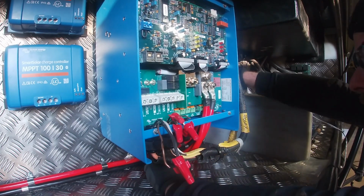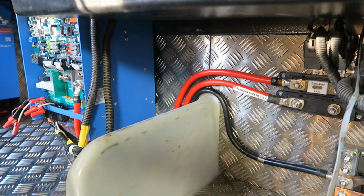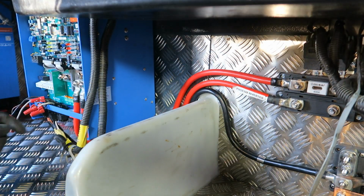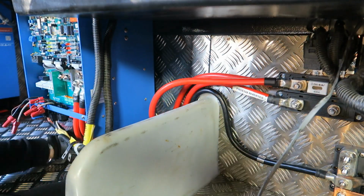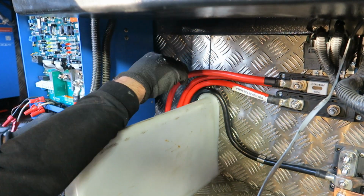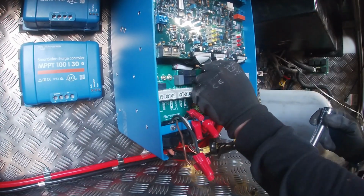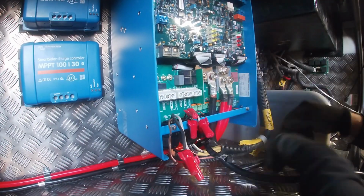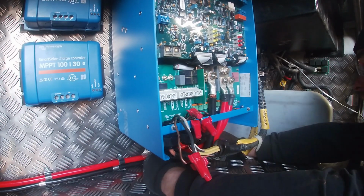This is a hybrid inverter, which means it has the capacity to boost grid power, which has really come in handy. We've now been living with this for 8 months, and here in Europe we usually get like 10 amps from our grid power, and this feature comes really handy as you can cap the incoming grid power. You can set it at 10 amps, and then if you temporarily use more, the inverter charger will actually draw power from the batteries.